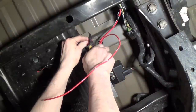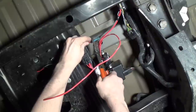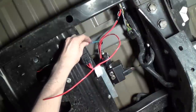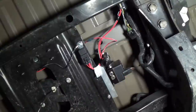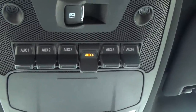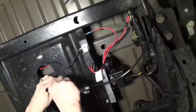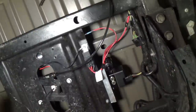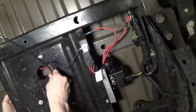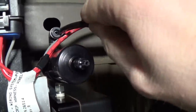The last electrical connection is the hot wire to the compressor and over to the wire provided on the wiring harness. The first air hose connection goes from the flexible compressor hose to the filter on the manifold. Air Lift requires that there be two and a half feet of distance between the two, so I just used a section of tubing and coiled it above the manifold, then made the connection into the manifold.